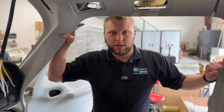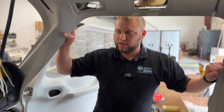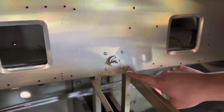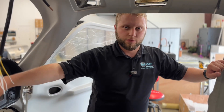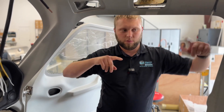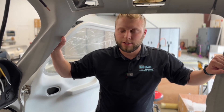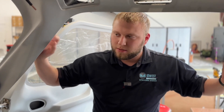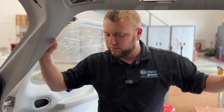There haven't been any major changes except for the relocation of a fuel valve. On the high wing, the fuel valve is not up close — it's actually remotely mounted, and your selector is a rod with a couple of U-joints that controls it. They relocated that a little bit, with some minor changes to the fuel system perhaps.